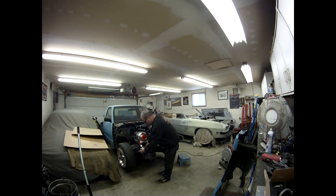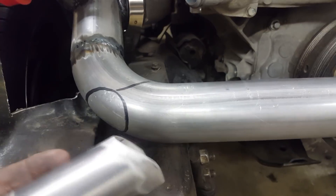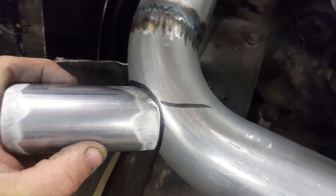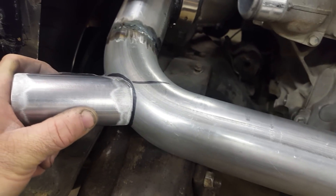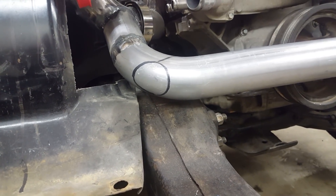Now that I got this off, I guess I have to concern myself with the intercooler piping clearance. Here's the little piece that I cut off. I want to fit it right where I circled it. I took this piece and ground down one part with a flap wheel until it fits. Because I'm TIG welding it, I have to have really tight gaps — it can't be like MIG welding where it doesn't have to be perfect. I obviously have to cut a hole, then that's going to go on there and the wastegate will be right around there. Here's the flange — it just goes on here and gets welded right on. Then I got to cut a hole in this pipe using a hole saw, clean it up, and weld it on.